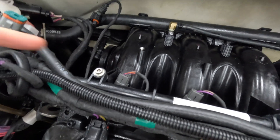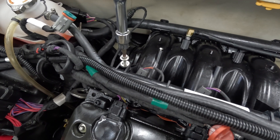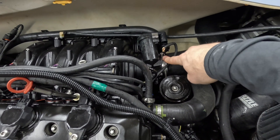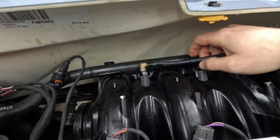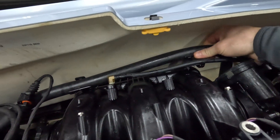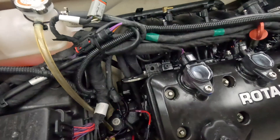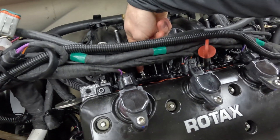Next I'm going to remove the two T30 fuel rail bolts holding the fuel rail in and pop that out. Then we're going to remove the hose connector holding the intercooler tubing to the throttle body. Towards the back, the factory 325 will have a blow-off valve hose — it's a plastic fitting so just pop off the hose — and also loosen the coolant hose there, just to get it behind the manifold and out of the way.